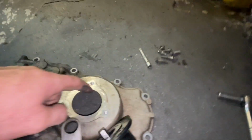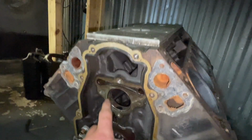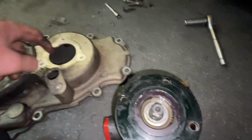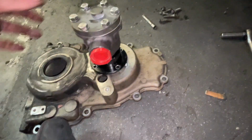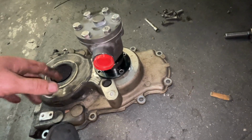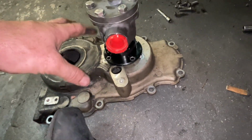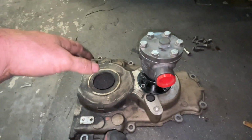Because I could buy a cam spud for $100 online that bolts onto the 3-bolt. That sticks a little stub out. That's a 3/8 hex like this. That'll stick out there. So if I can buy a $100 spud and then take this cover right here and modify it, then I'll get Nigel to put me a drain in it. Then heck, we'll be already on our way to what we need for our front drive fuel pump setup. I won't have to buy a balancer or nothing. And I'm pretty sure all this other stuff right here will clear the way I need it to clear. So y'all ride with me. Let me check this out real quick. That'll be fine.